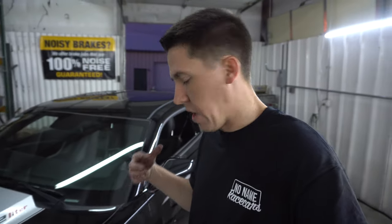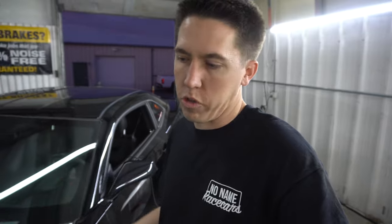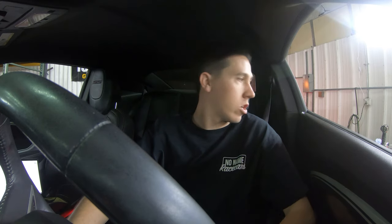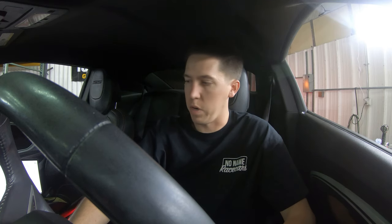The cam definitely needs a lot of idle tuning, so I'll start off with that. I brought my tuning school book. I'll work through the idling, then part throttle, then full throttle. I went ahead and made some idle changes and got everything unlocked. I'm going to go ahead and start it, roll it up to speed, and make sure everything looks good on the hubs and make sure it idles better and doesn't want to die right away.